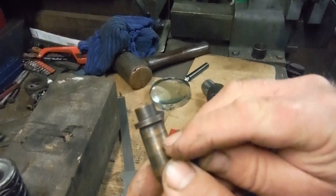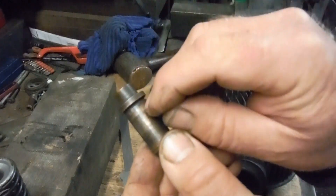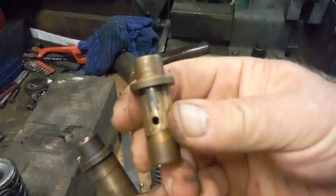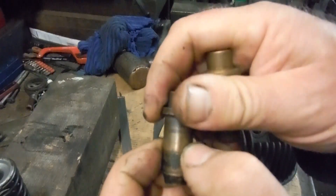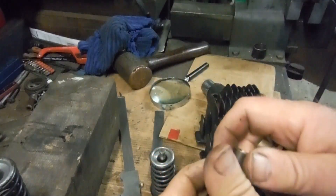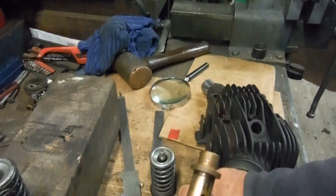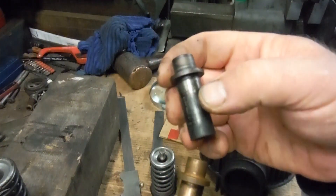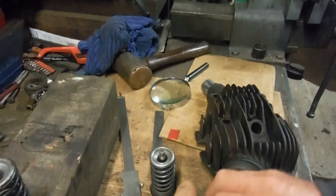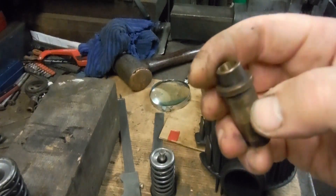What I'm going to do is drill an oil feed hole at the right depth from the underside of the flange, as per the inlet guide, but I'll also run an annular groove around it level with the hole — this really should have had one. I'll also make sure the exhaust replacement is similarly modified.